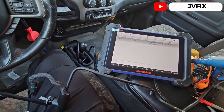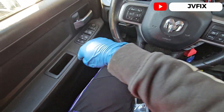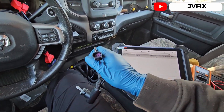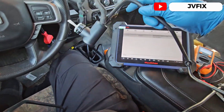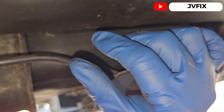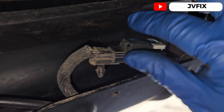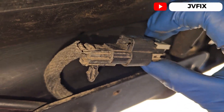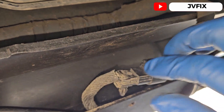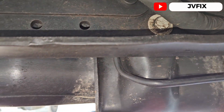The way to check if it's bad — you gotta get under the vehicle and disconnect the connection. It's going to be on this side right here at the very bottom. I'm also going to film the process of taking this line out. So I'm under the vehicle — this is the line right here and this is the heater connector. If you take the heater connector and use the multimeter in continuity mode, you can put it across and you will see if your heater is good or not. I already did and it actually has a circuit open, so the resistance in there is broken.